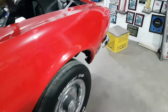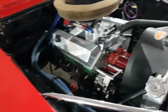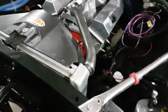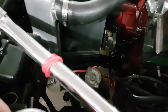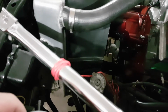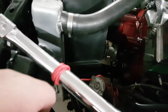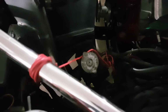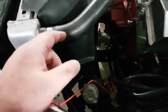and then I have to go up in my stockpile of small block Chevs and find a crank pulley and get that to fit, because as you can see, I still have the single row on there that's just for the alternator, and it's the small diameter. I need a 2-row because I have power steering on here, so I gotta bolt up the power steering pump. Then I have to put the crank pulley on.